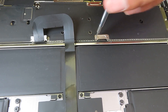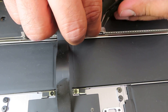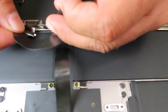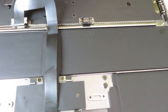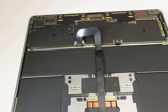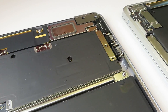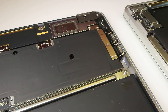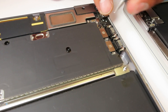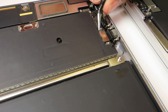We've probably taken thousands and thousands of laptops apart before, but I've never seen such a complicated assembly as on the 2022 MacBook Air. First of all, as you can see, every connection has a closing lid which is screwed down with at least two screws. Right here there are four screws covering the connection for MagSafe and the two Type-C ports.